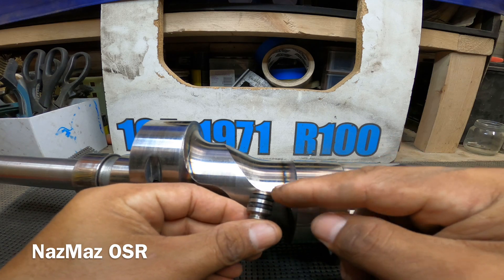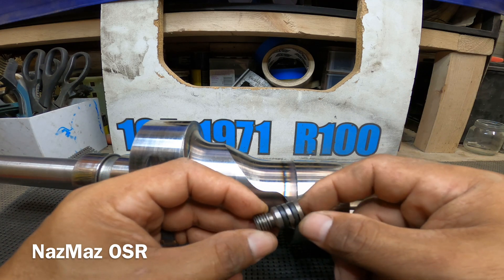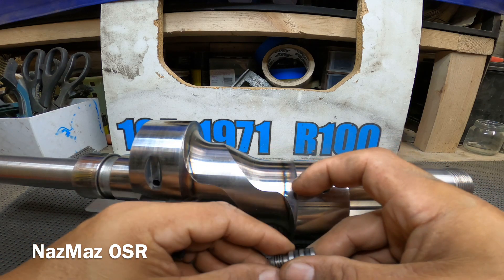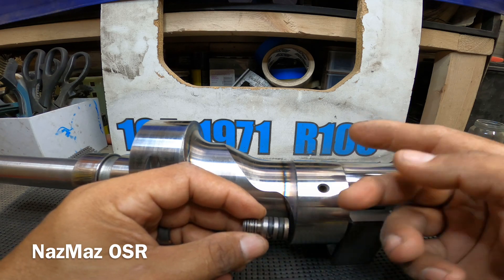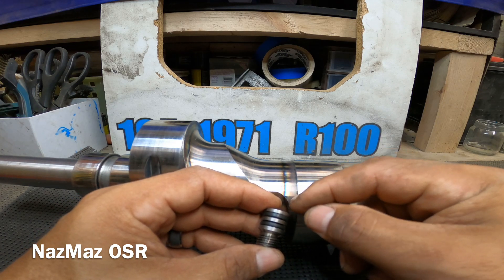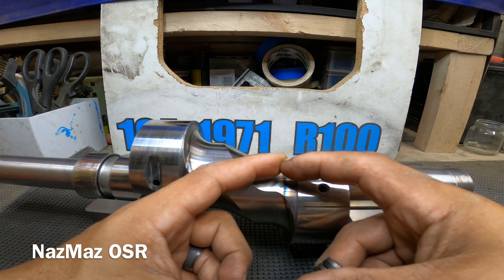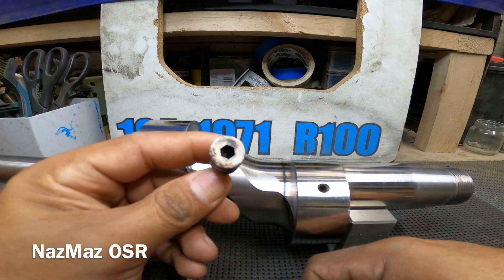I'm gonna have to switch these o-rings here. It's a 10A — it's been there over 50 years — so I don't want any oil leaking out. If you guys have any 12As and you change that big o-ring that goes in the back — that big orange one — and your engine is still leaking from back there, chances are these smaller o-rings here are probably worn out or partially torn. Wear and tear — they wear out, and the more you rev it and the hotter it gets, the more it'll leak. Usually it's that big orange donut-looking seal that's the dead giveaway, but if you swap that out and it's still leaking, these smaller ones might be the culprit.